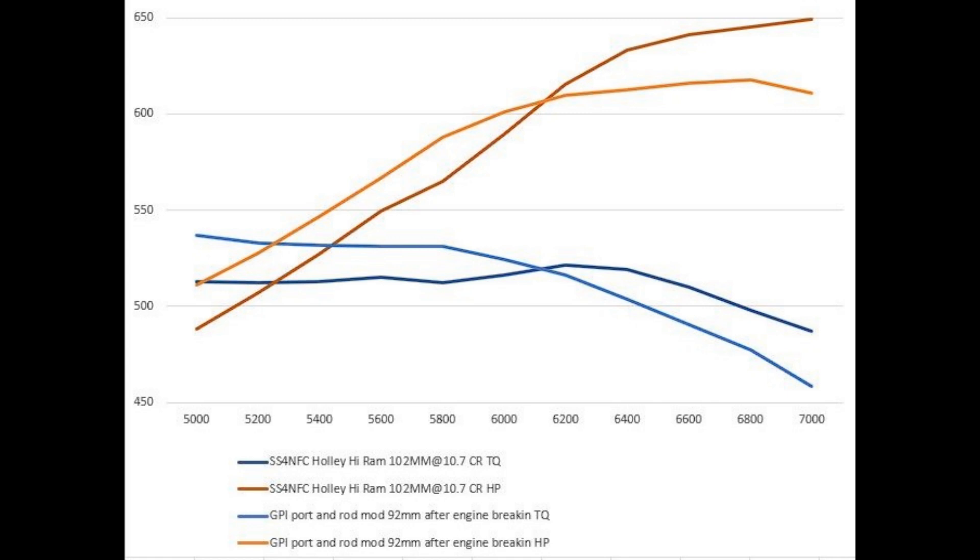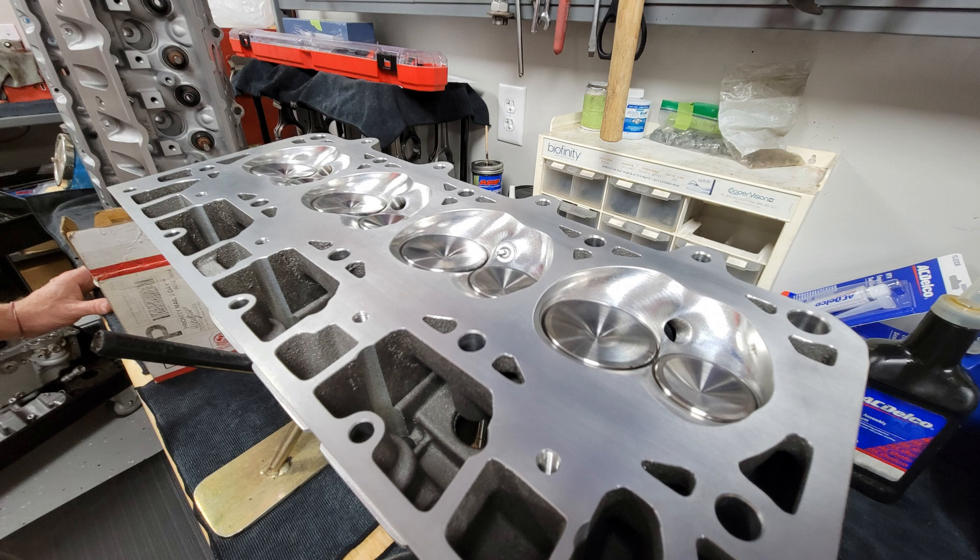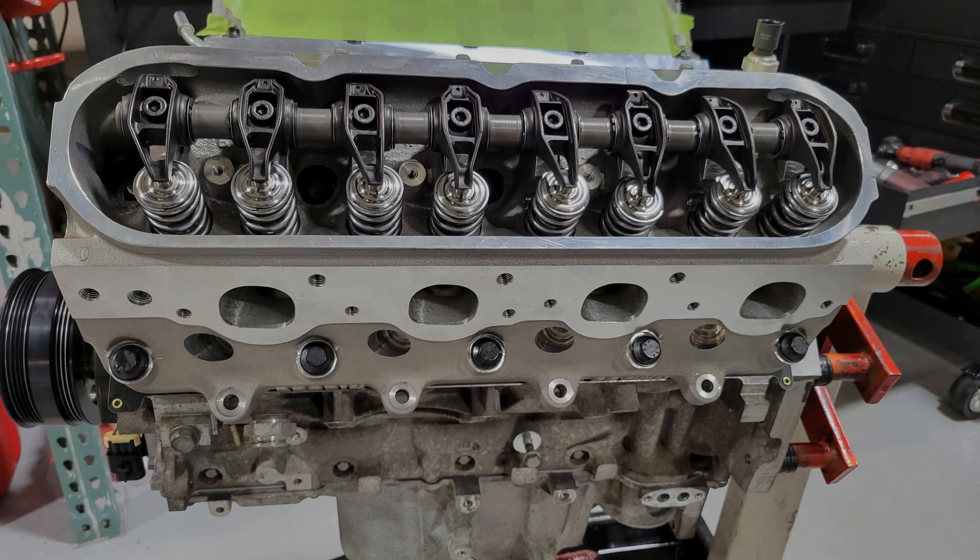This impacts a couple of key areas: the valve train, torque converter, and rear gear ratio. For 7,600 to 8,000 RPM, you'll need lightweight intake valves — either a hollow-stem LS3 valve or a titanium valve. You're going to need a valve spring that's 160 pounds on the seat and 470-plus open. With that sort of spring pressure, plan on either a bushed trunnion rocker or a shaft rocker system, and a high-quality, preferably short-travel lifter like a Johnson 2110R or a 2116 LSR.